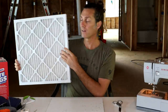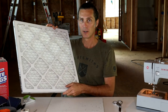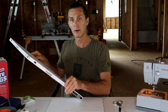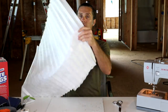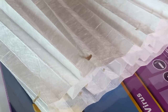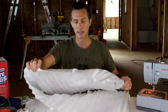I got other filters in the mail where the metal mesh goes up and down into the peaks and valleys with the fabric, and taking this metal mesh off actually destroys the fabric. Then it doesn't work as well for filtering viruses. The other filter actually has a higher rating for filtering smaller particles, however you destroy it by pulling it off. So basically to get it off, you're just going to rip off the whole cardboard, pull off the metal, and extract it from its cardboard case. Once you have it out of the case it'll look like this — just kind of accordion out. There's going to be glue on the edges; you can slowly pick that off or just choose not to use that area.